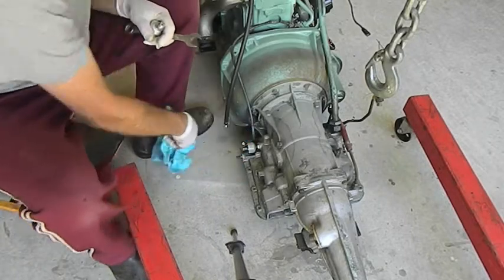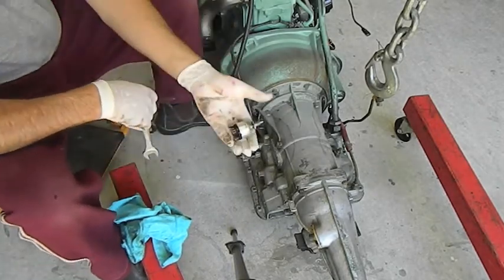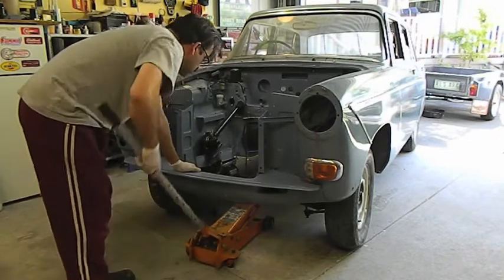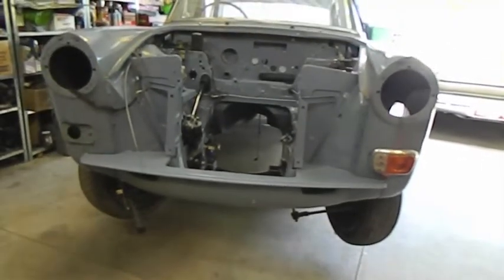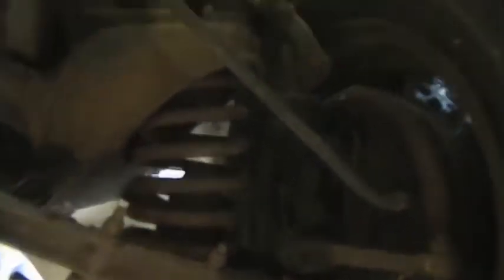I've made up my mind that today was the day the engine was going back in the car. I thought this inhibitor switch was damaged — if it's hard to get in after I put the engine in, so be it. The engine stand's looking a bit naked now. Nice and easy to jack up with no engine in. Let the games begin. I always wondered why the passenger wheel would try and self-centre where the driver's side stayed where you put it — it hasn't got the drag link or tie bar hooked up. But the reason it's trying to self-centre is the hose is elasticising the thing back — clearly the wrong hose and really, really dangerous. It's a good thing we've got three new ones to put on.